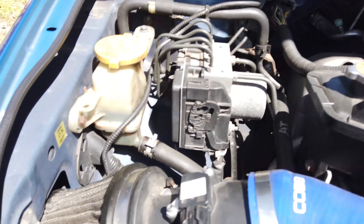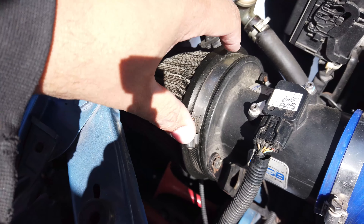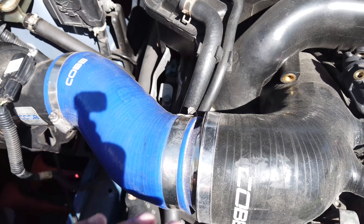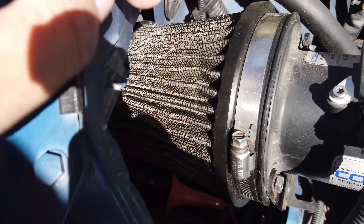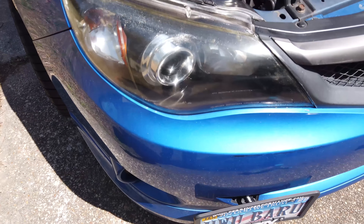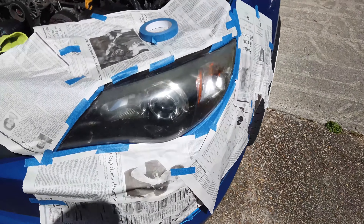There are a few things I need to show you guys that I didn't cover on YouTube. First, two weeks ago I went ahead and cleaned my intake. I'm probably gonna have to get one of those splash guards — something that basically goes around the intake — because I got this giant massive turbo inlet here. That pushed my intake down, and I believe I've been getting some debris — possibly water. As you can see, after cleaning, there were some leaves in there. So I gotta get one of those guards.